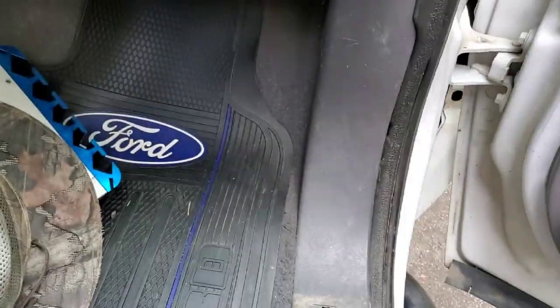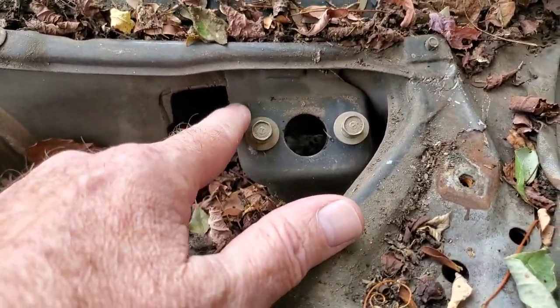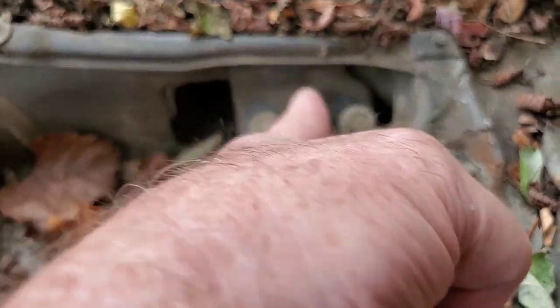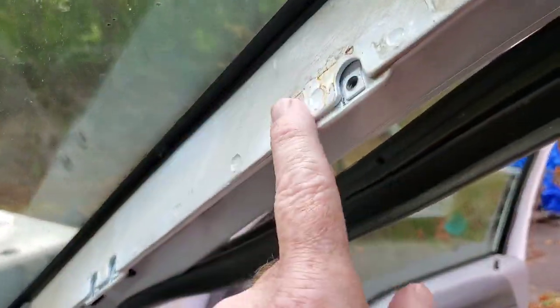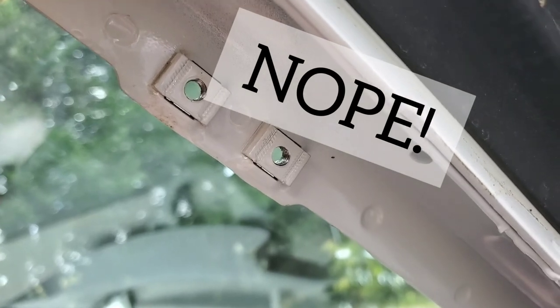What I think I'm going to do is clear away the dry leaves, then get an angle grinder and cut this bracket out. I'll have to cut it in half, shorten it to make the holes slightly closer together, then re-weld it. When I drill my holes and add those captured nuts onto the back side — similar to what we have here — and tack weld them in, I think it'll work great.